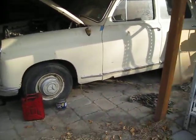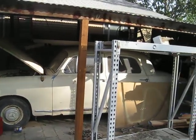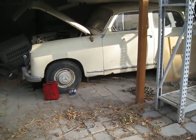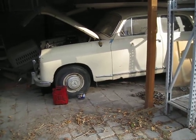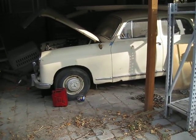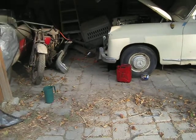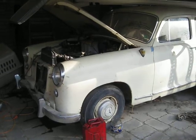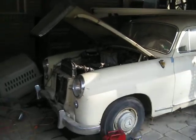You know, I got this from some guy who inherited it from his grandfather. I think he's some sort of engineer, but not mechanically inclined. And anyway, I got the thing and man, it would not run. Wouldn't start, nothing. No fuel, no nothing. So start with a fuel pump. If you buy one of these diesel cars, start with a fuel pump. Just pull that off and rebuild it, because that's the heart of the car, really. I think it was like $500 to rebuild the fuel pump.